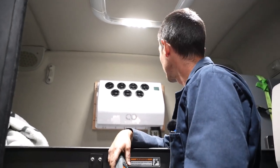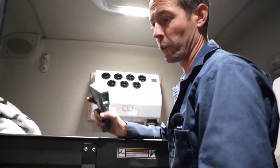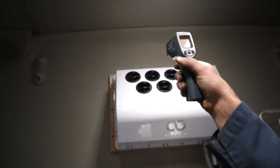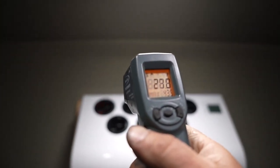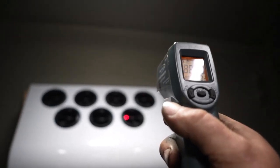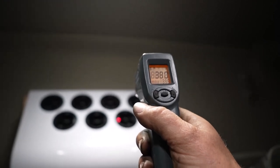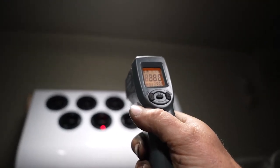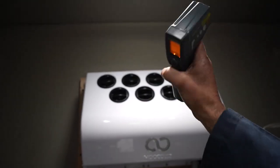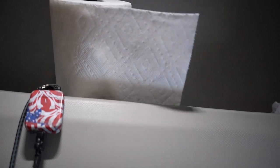We've been running here for about 20 minutes and I wanted to check the temperatures. With a digital thermometer, right on the coils we're reading 29 to 28 degrees Fahrenheit — actually as low as 26. Down here on the bottom, about 38 degrees. So on the other end of the coil we're in the mid-30s. Real good airflow — you can feel it all the way up in the front of the cab. We're going to let it run for a couple of hours here, check the performance of the batteries, and get this thing wrapped up.